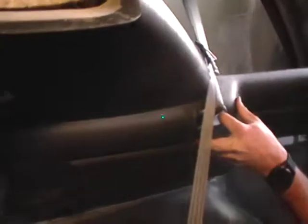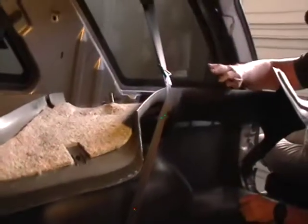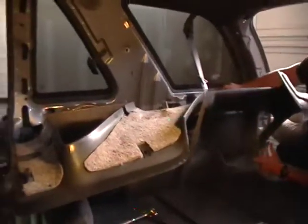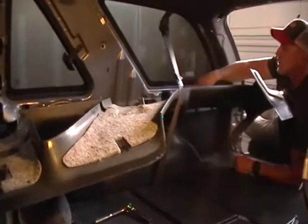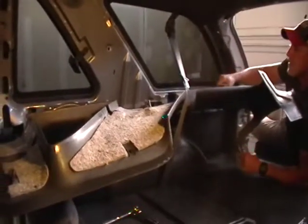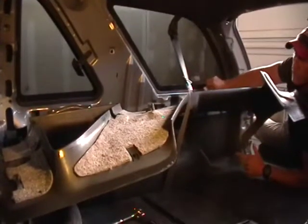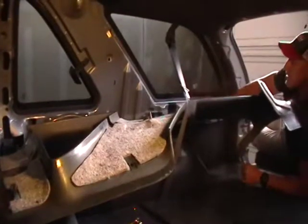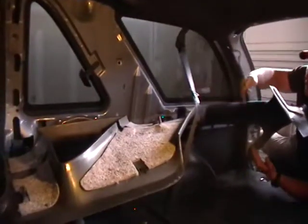What you'll want to do is just kind of swing it out and back. You're going to use this type of access for getting to your speakers on a speaker replacement — on a two-door Blazer you use a six-by-nine. You're also going to use it because after years of rattling down the road things start to squeak and rattle. So instead of using foam, I'm actually going to use hook and loop Velcro attached to various parts of the body and also where the pieces of plastic meet together.